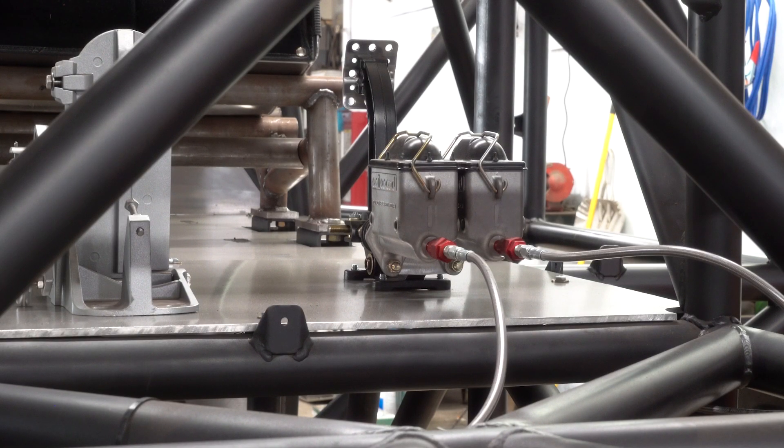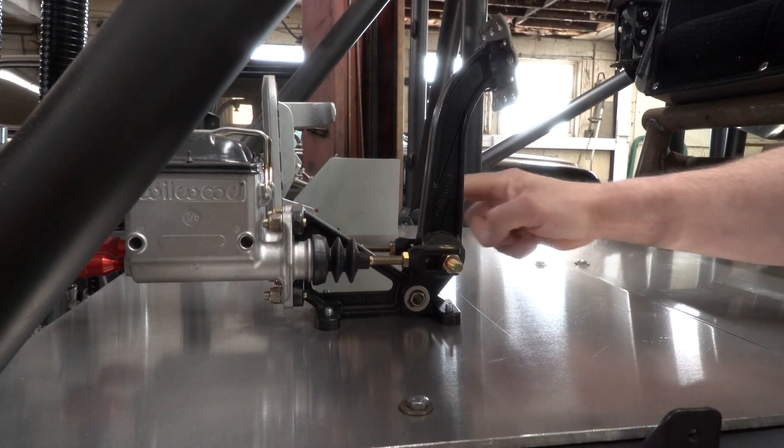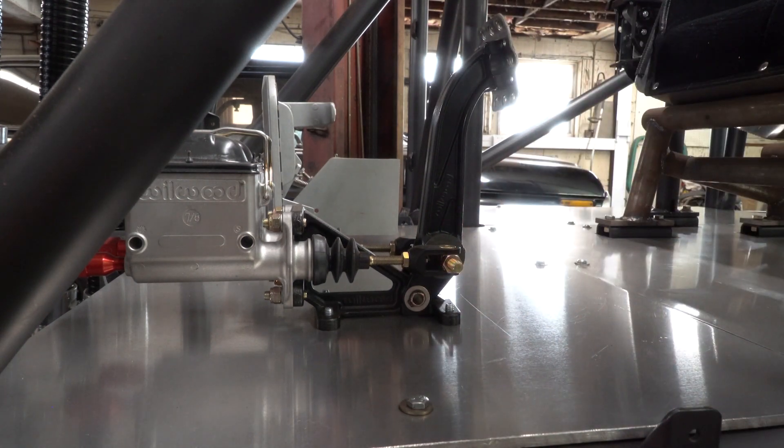Right there you can see the brake pedal mounted with twin Wilwood master cylinders, and those little red pieces at the end are residual pressure valves — I talked about those in an earlier video. You always want to run them as close to the master cylinder as possible, so here I screwed them directly into the master cylinder. It's a simple design: you push the pedal, it pushes a bar called the balance bar, which is adjustable. If you wanted more pressure to the rear you'd adjust it, but in this application since the drivetrain is locked in four-wheel drive, you'd want to adjust both equally.